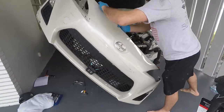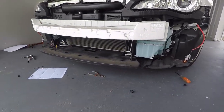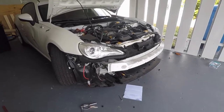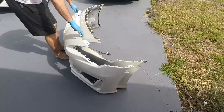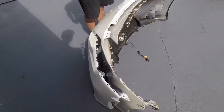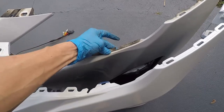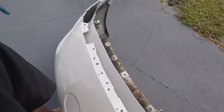Here's the bumper swap. It's pretty easy to slide off once the clips are removed. Here are the two bumpers side by side — the one on the right is the FRS, the one on the left is the BRZ. All the clips look like they line up to the eye, but we find out later they're not exact. There's one right there that you have to shave off, and a little divot where you have to cut in, which we didn't do until later.